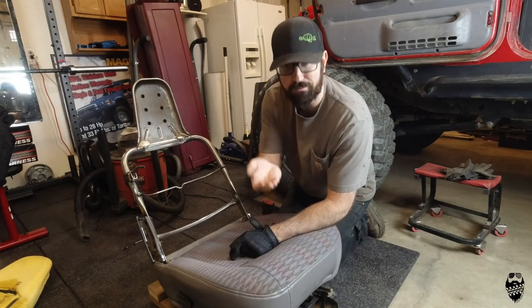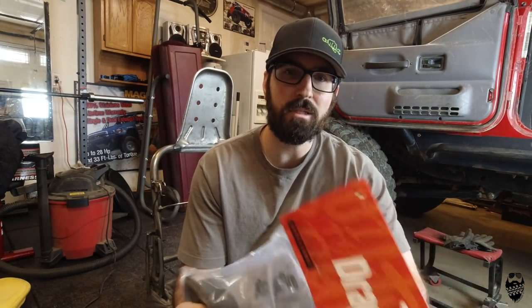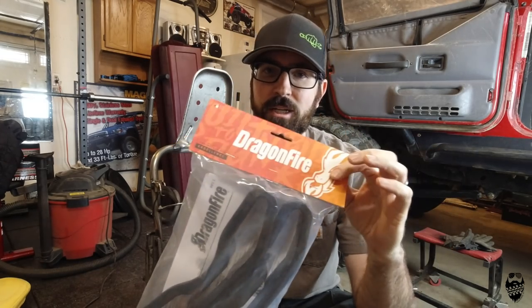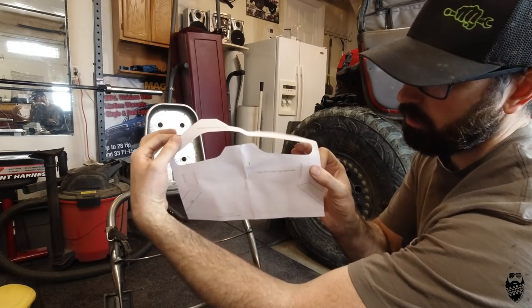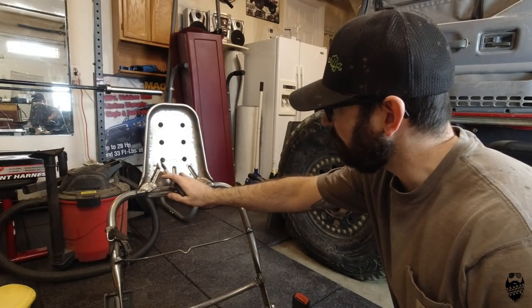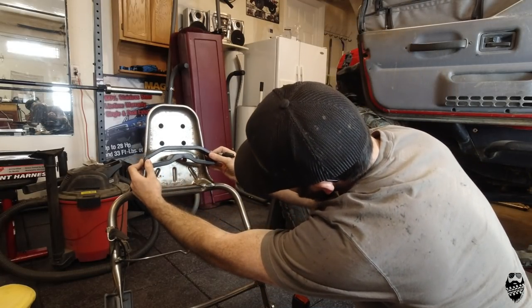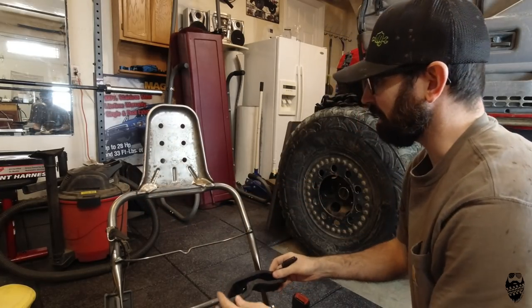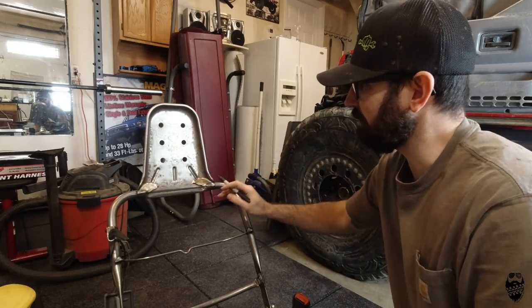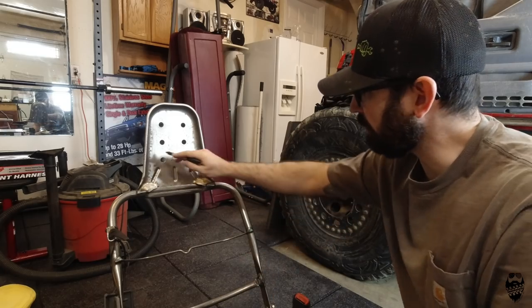Found some money — seven cents. The harness pass-through I'm using is the Dragonfire Racing Harness Pass-Through for a Polaris Razor. It's on Amazon for about $21, price can vary around $21 to $25. I'll leave a link in the description. I took the template from the kit and cut it out. Everyone is going to have a different setup based on how tall they are and body type, so I'm going to put the bottom of this right in the middle of these two holes, then mark and cut from the back side since it's more flat.